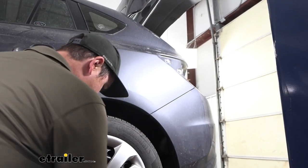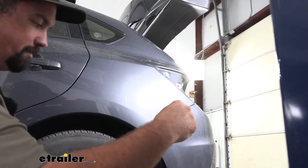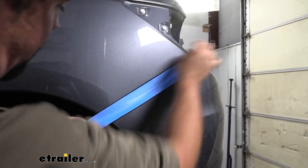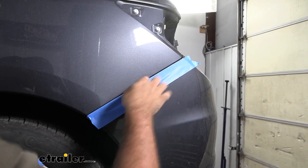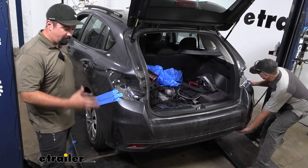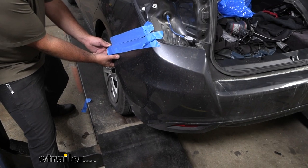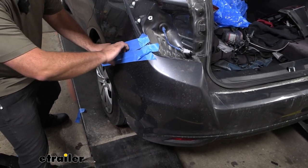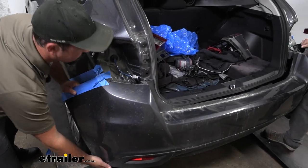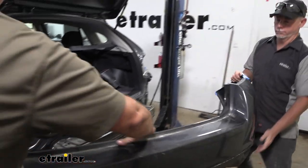Something I do just to prevent any scratching while taking the fascia off and putting it back on: take some painters tape and just run it along this seam on both sides. This is to make sure that the clear coat doesn't get scratched as this can rub back and forth as you're putting it back in place. To get the fascia popped off, just kind of lightly pry back — there are some plastic clips, so slowly make your way with your fingers, don't put a lot of force, it should come off fairly easily. Once we have it popped off, we'll set this aside for later reinstallation.